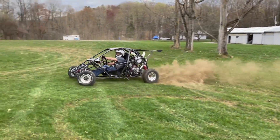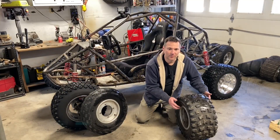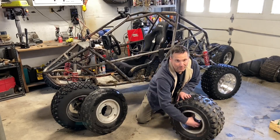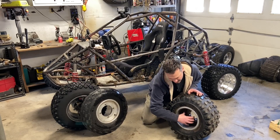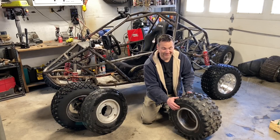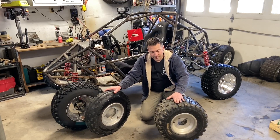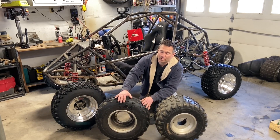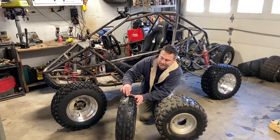The back wheels on an Outlaw are nine-inch rims, eight inches wide, two-plus-six offset — flat on the outside and deep on the inside. I haven't found a way to get nine-inch wheels to work with my setups; it's a small area to fit a hub and suspension without rubbing. These would look cool like cross cart wheels on ATV tires, and the rear end hooks up really well with cool lugs. But the fronts work absolutely terribly — they were not made for a wide front track width and you're basically riding on just the center ribbon.